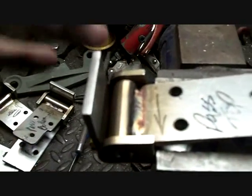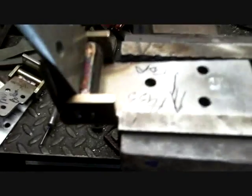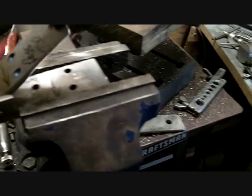There was a little struggle from the heat. The bushings had expanded while they were hot, and you could not move this thing. Kenny put a pry bar on it, and we could move it. Once they cooled down and I put some oil on them, they're fine. If I take the vice grips off, you can't move them by hand, but with just a little bit of leverage, they move nice and easy. I'm going to set them on there just to see what they look like, just the passenger side. I'd love to put the door on, but...